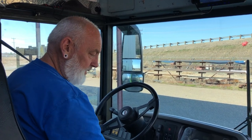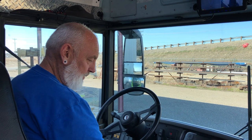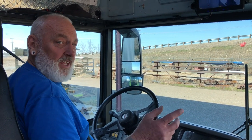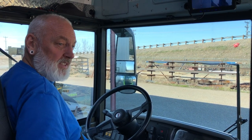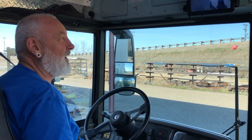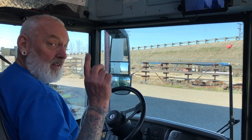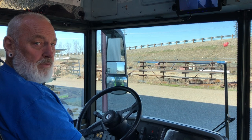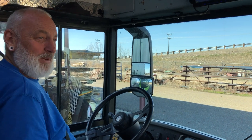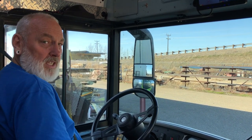We know it works super awesome because when it was set to full-size truck, the brake test locked up the tires and skidded them. So we went down to small SUV and tested it again and it worked really well - it just stopped the bus. This connectivity problem is the first thing I thought about with this system. I even asked them before I started whether Bluetooth would be a problem through the metal skin of the bus and they told me no. But I'm betting that's our problem. The cool thing is once that brake was set up and powered in the tow vehicle, it's still working even though it's not showing us what it's doing.